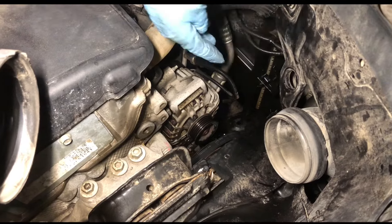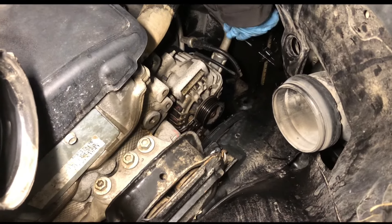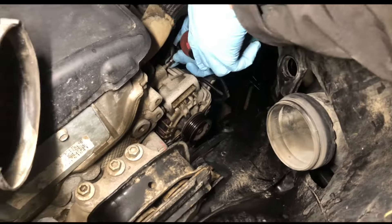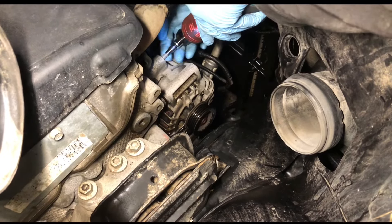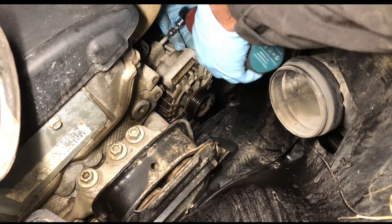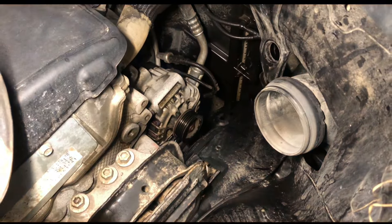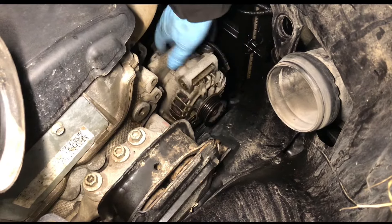The issue is the AC line right here is in the way, so you have to pull it out. To bypass messing with the AC line — because you don't want to bend it or tamper with it — we're going to take this bracket out right here. Take a 5 millimeter and bag it out. It's pretty long. Go ahead and take that out with your 5 millimeter, and then the alternator just falls right off just like that.